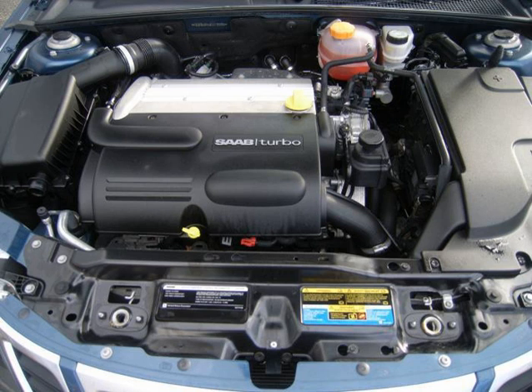The Gen 2 block is similar to the 2.4 L and also features VVT technology. The Gen 2 block was developed using data from racing programs and computer simulations. The bore walls and bulkheads were strengthened with a weight increase of 1 kg. The coolant jackets were expanded to improve heat transfer, resulting in a coolant capacity increase of 0.5 liters.